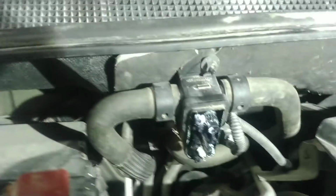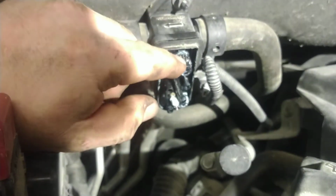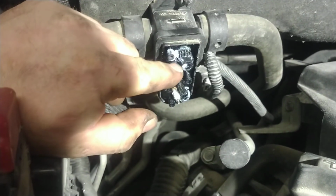Why have something that works good when you can make it electric? Your heater modes and everything inside have gone to the same style of electric actuator. Now, I'll give you a clue. If you get in your vehicle and you start it up and you hear pop, pop, pop, and you shut it off, and it's still sitting there going pop, pop, pop, it's probably one of these freaky little things they use to move the doors inside, and that gear right there will start to slip.